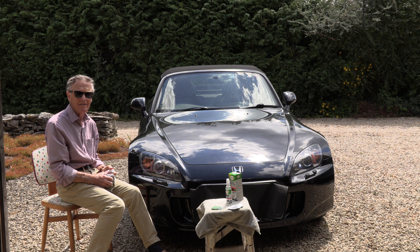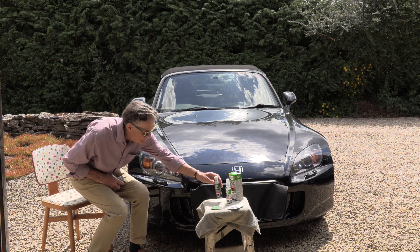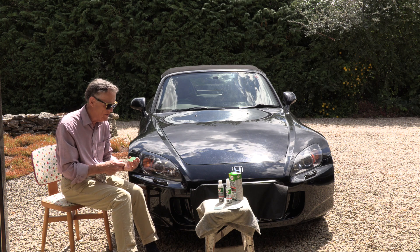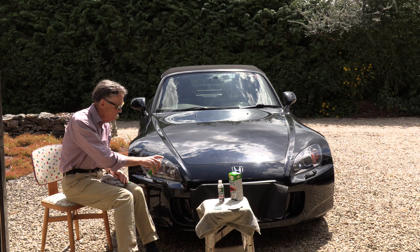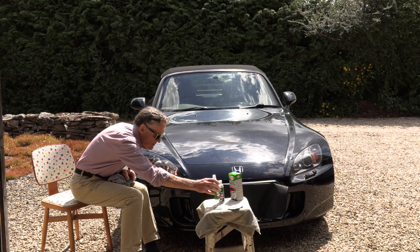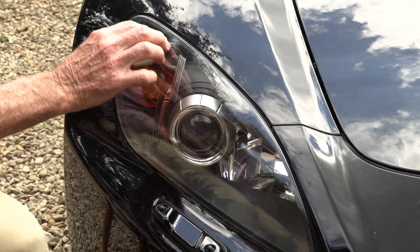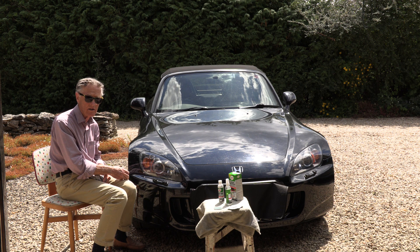So we're assuming that they are very bad and the clarifying compound has not shifted it. So here's what we do. You take the number one pad, which is an abrasive pad — it's coloured green and it's got a little one on it. You take the lubricant spray and you first of all spray the lens, you also spray the green pad. You then work over it in horizontal lines like so. If it's bad this will take quite some time — you could take an hour and a half per headlight just to do the green job.